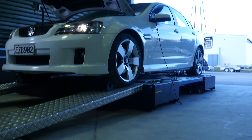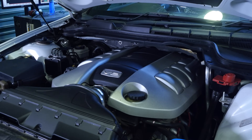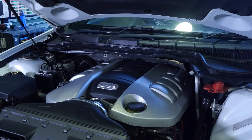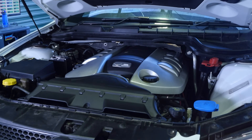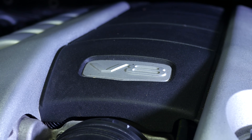If you live in a part of the world which never received the Holden Commodore, or perhaps you've never heard of the L98 engine, don't worry — the L98 engine is essentially identical to the much more common LS2 6-litre V8. The major difference being that it uses the rectangular port L92 cylinder head, which is superior to the LS2's cathedral port head.